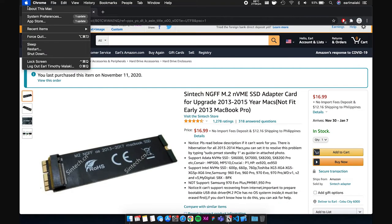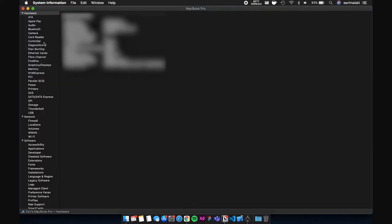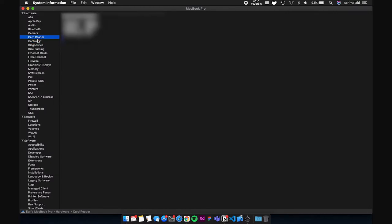Next, the Mac you're planning to replace the SSD on must have at least High Sierra installed. The reason is that macOS High Sierra was the one that brought NVMe support for these Macs. So before you replace the SSD, make sure to install macOS High Sierra on that machine first so that the firmware and read-only memory has the code that enables it to understand and work with NVMe drives. Also check your volume type — whether it is APFS or Mac OS Journaled — as this will be useful later when you format your new SSD and it should match the format of the old SSD.